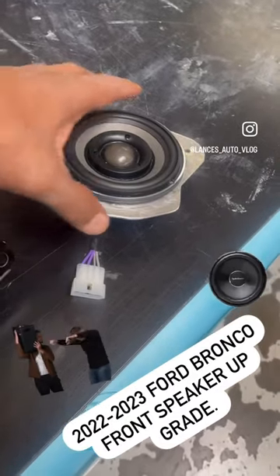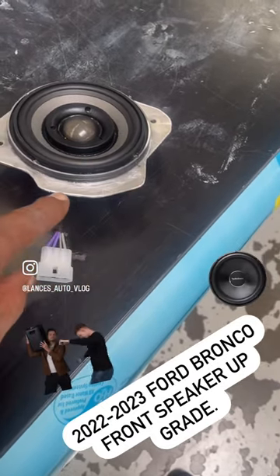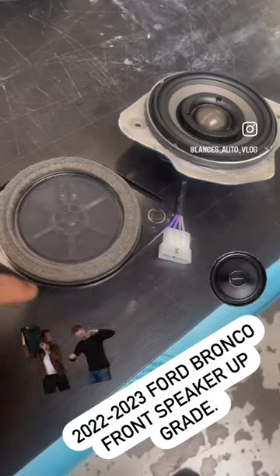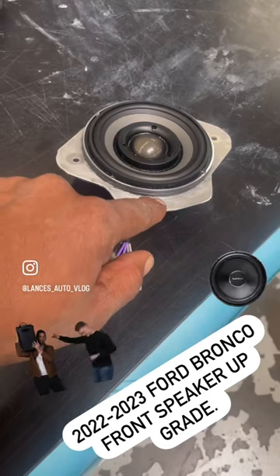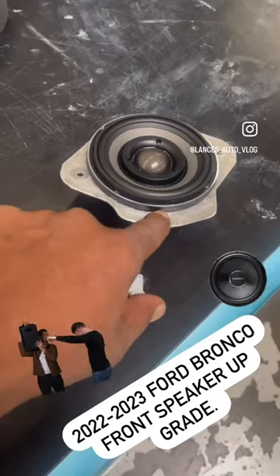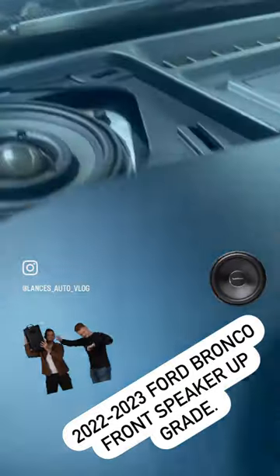It's going to go in the dash. What you see here is that Mike went as far as making a bracket to cover the open space — when you put this driver in, there are actually open spaces on the front side of one side and the back side of the other. That allows the speaker to still play, but it's not baffled really well. So we're going to baffle it with this bracket. Everything's put together, we just have to install it — so stay tuned for the next video. And boom, speakers mounted.